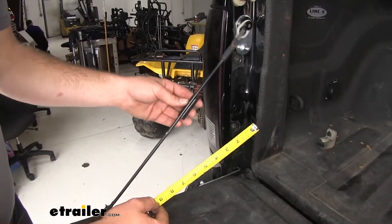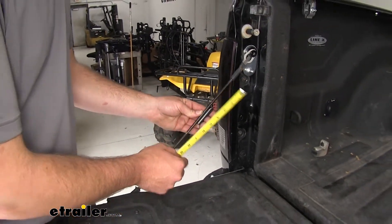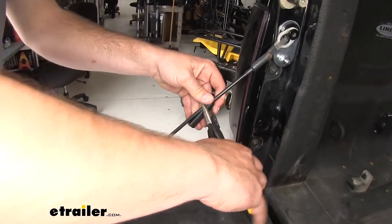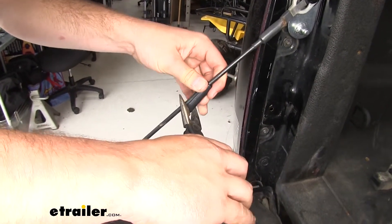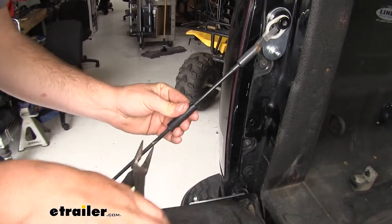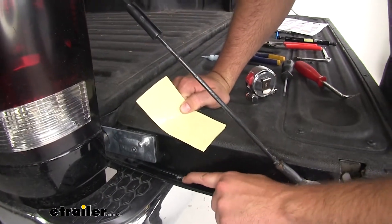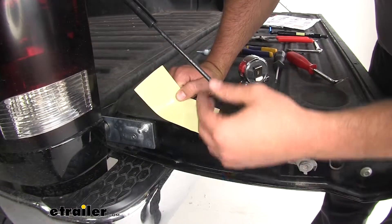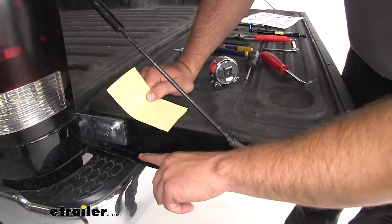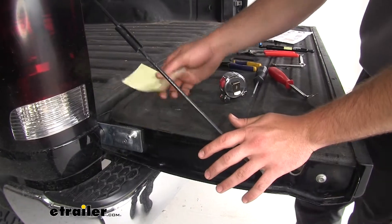Then you're going to take your plastic cable protector, measure about three and a half inches down per your instructions. I found it easiest to take a pliers just in order to get that cable into place, otherwise it can be a little difficult. Included in your kit is going to be a Mylar sheet — it's a protective sticker. You see this paint spot here that's missing? This is a wear spot from where the cable used to be. This is going to help protect your paint on either this surface or the vertical surface on your end of your tailgate. This step is optional, and we're going to leave it out.